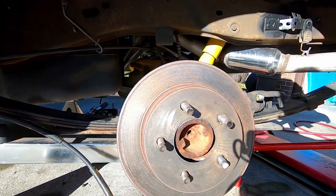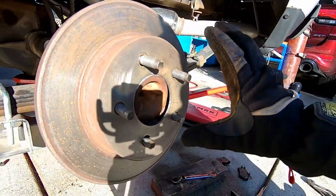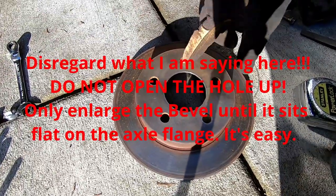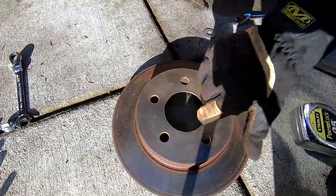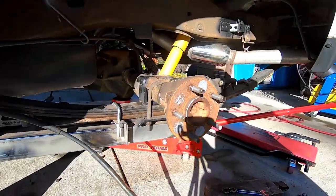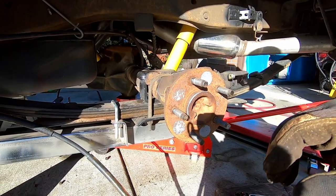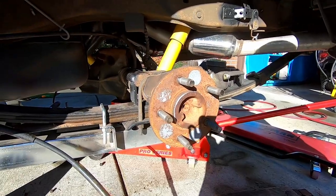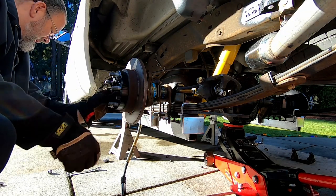I'm glad I took the driver's side back apart because we could have had a failure. The rotor was not all the way up against the axle flange even on the side I had completely assembled. I ended up taking a carbide burr and a 90-degree air motor and evenly opening the hole up until it fit flat, trying to keep it as hub-centric as possible. Then I put a little bit of anti-seize inside the rotor hat to verify we had witness marks that it was going all the way flat. This can happen even on other brands when you do custom disc brake installations — always keep in mind that your rotor is sitting flat. This is a hub-centric wheel spacer.